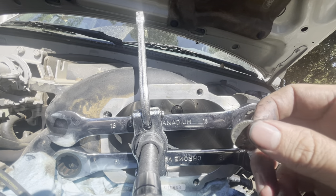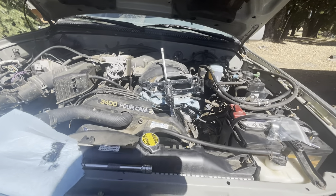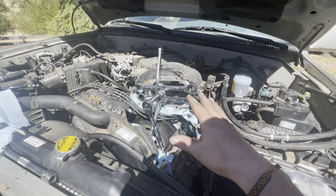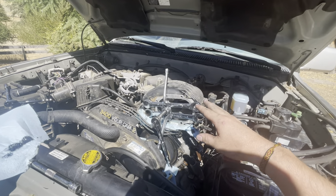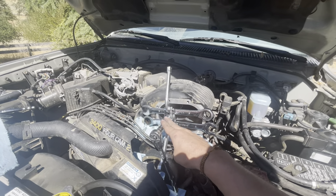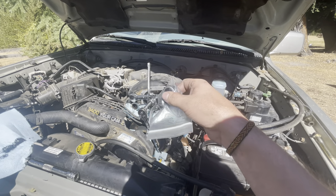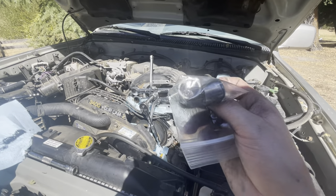You're going to slide this on and then make sure it's flush with this. Hope this helps anybody. You can totally do this job with it still installed on the motor, so don't think you need a press or any fancy tools. This kit was, I think, $50 — this Polar set was $50 on Amazon. I'll put a link below, as well as a link for a full rebuild. I've already rebuilt the nose cone, but this was just another big job that I needed to tackle because it was getting pretty noisy.